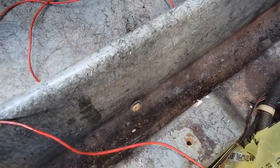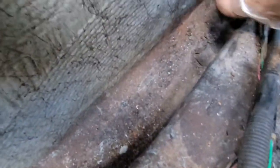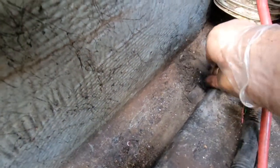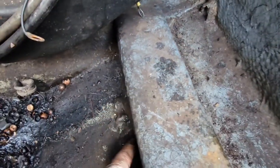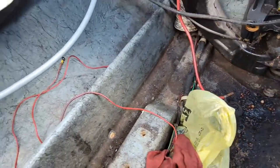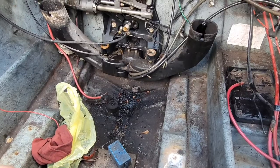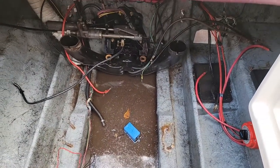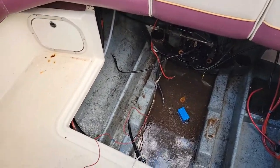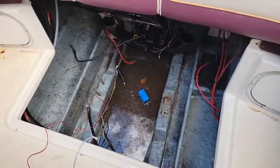One of the biggest things I love about doing an engine swap is getting this stuff clean. I could take a screwdriver to all this and just bust it loose — it was dirt all piled up in here so thick, and I just don't like it. I definitely want to get out the bigger stuff. I've been getting out the acorns so they don't clog up the little drains. You always want your drains clear — this one from the stringer goes through and comes out into the lower bilge. We're going to get all this cleaned up. I'm going to have to go down and clean that drain hole out, let that drain, then hit it again after it drains.